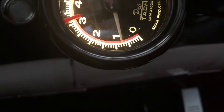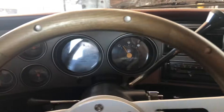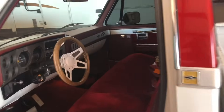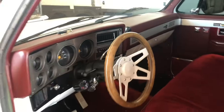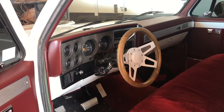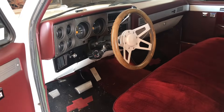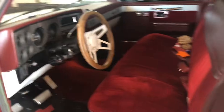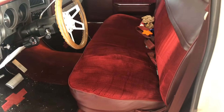You can see we're hanging out right about 750. So I think we solved our issue of having it stall out when we go into reverse or drive, or just pull up to a stop sign with the AC on. It's real simple to adjust the base idle on these TBIs as long as you follow the steps, which are all pretty simple. Using that wire for your OBD-1 saves you a lot of money versus buying the actual code reader that does the identical thing.